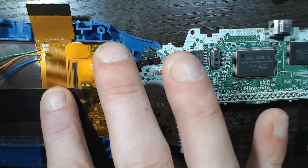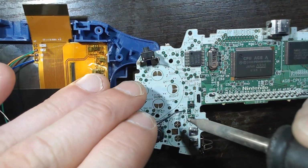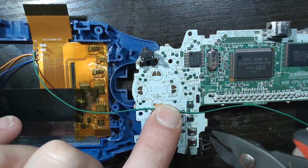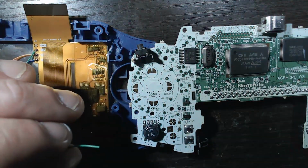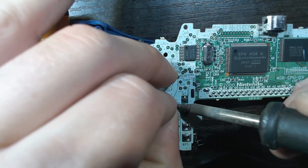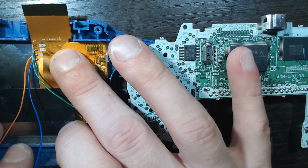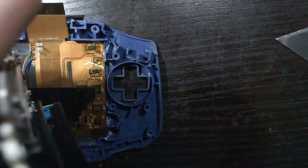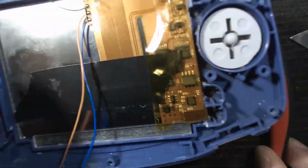Now select, we're going to solder that select wire to TP2. This setup works for me. It keeps it nice and taut, just having it folded over to the left there. Now this is on the front of the board. I find this to be a good amount of slack to work with. If it's too taut, you can't really fit the board back in. I route my cables towards the bottom there. And give your select cable there a nice tug towards you before fitting in the board.